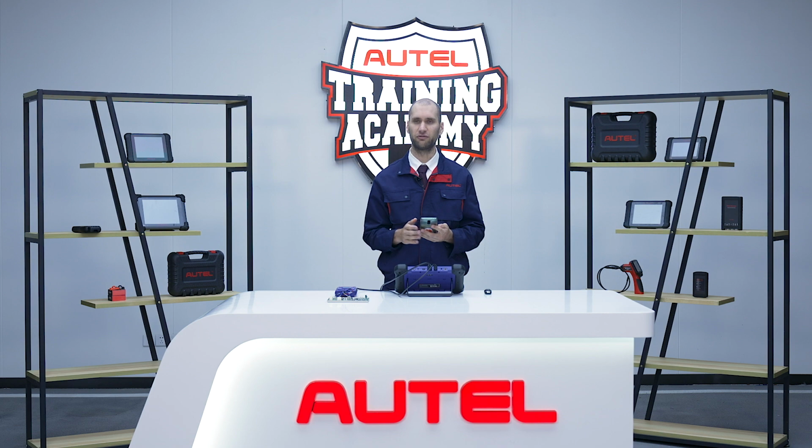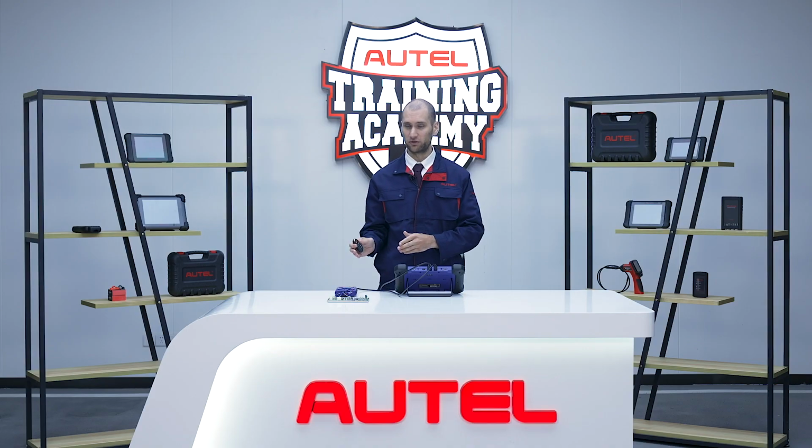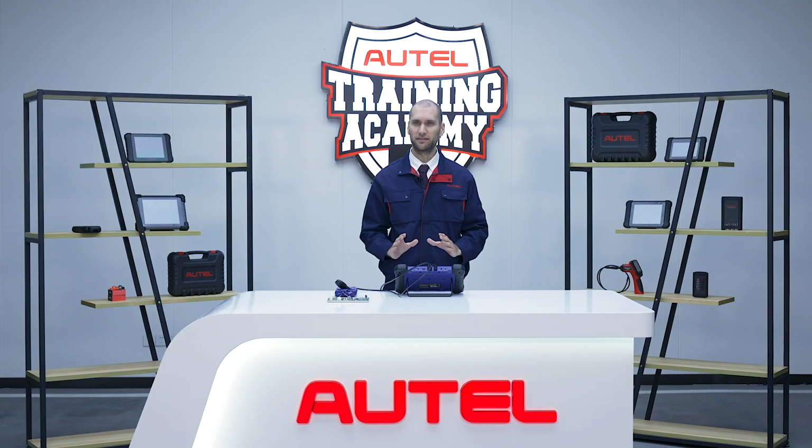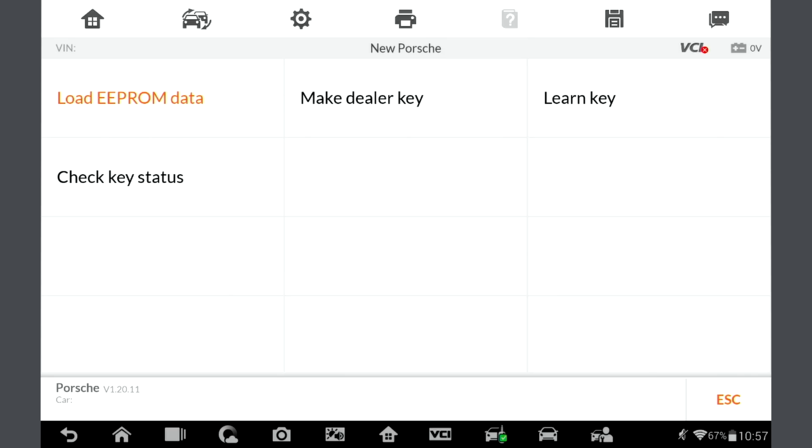It may be beneficial for you at this point to take a picture of the information, just in case it doesn't load in future steps. Press OK. You need to have a fully blank key for this. Place your blank key in the XP400 Pro key programmer. Now we can select Make Dealer Key.